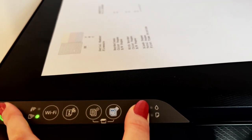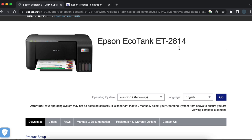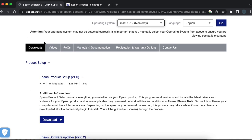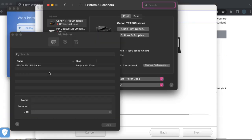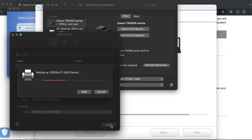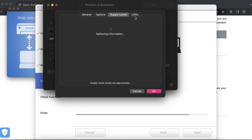The PC I'm using is a Mac, so I'm going to show you how to install the driver on your Mac, how to print, and how to print with the ICC profile for sublimation. I'll add the link below — you click on it and install directly. You choose your operating system, language, then go to the Downloads tab and select product setup or the driver. I've already gone to my Mac's printer settings and I'm going to add this printer to my list. Once it shows up, you click Add and it will be all set up. You can see a little green light meaning I can use it — but we're not done yet because I still need my ICC profile.